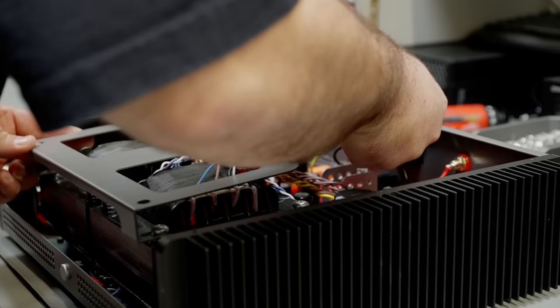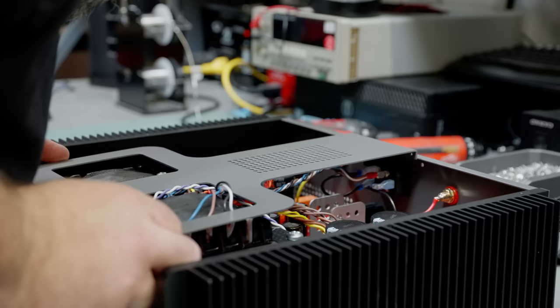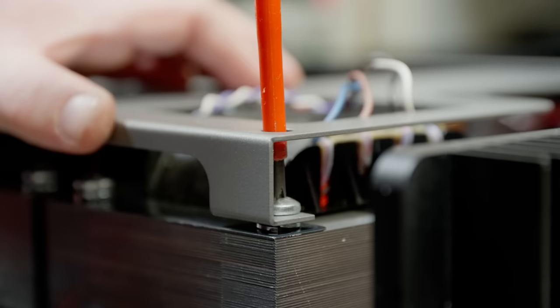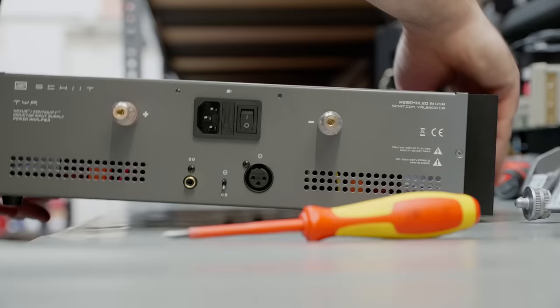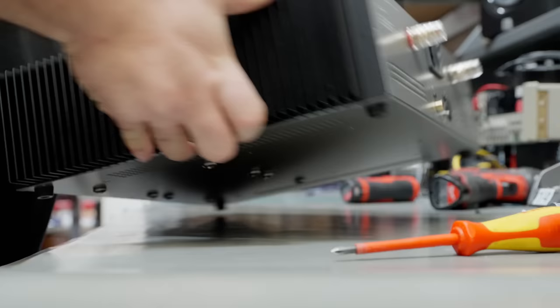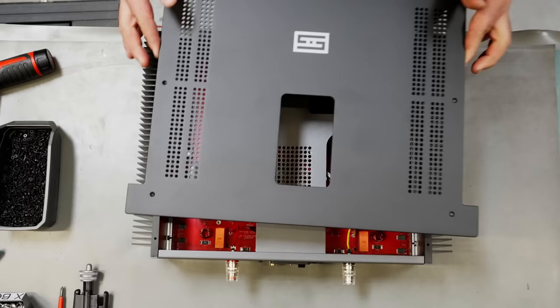From there, they do something that's a transformer feature — an inner piece of steel that goes over the transformers. Let's face it, they're not the most exciting looking things. But it does one really important thing: it actually allows a lot more airflow out of the chassis. The transformer feature has a perf that sits way below the top and lets us get a lot more air out of the chassis. You'll notice Tyr has perf all over it — front, back, sides, top, bottom — because it does actually run pretty hot and needs to move a lot of air.